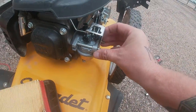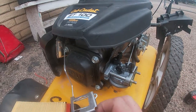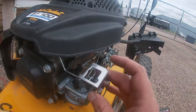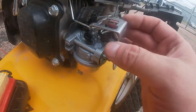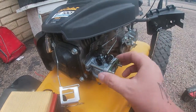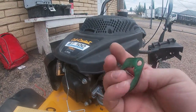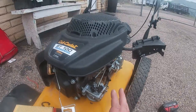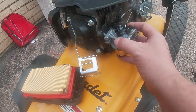Memorize what this looks like. This part is for anybody who took this apart and doesn't know how to put it back. This choke piece is going to go to the side — when you put it back on, you want this part, the choke, in between these two prongs. It has one hole, not multiple, because that's the automatic choke system. And remember, this has two gaskets — a harder plastic and a lighter one. Green goes outside.